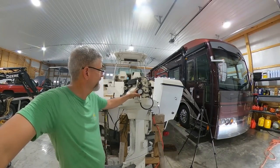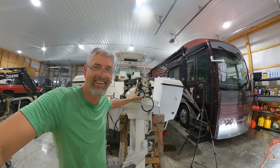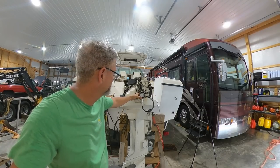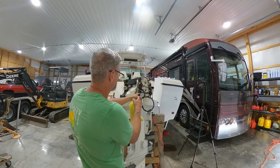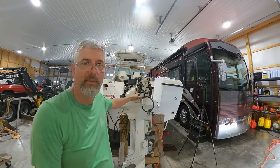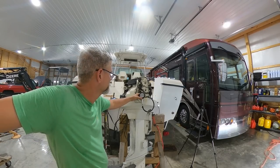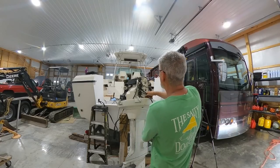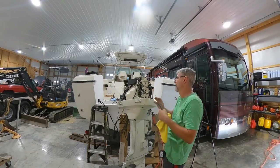All right, I waited and ran it again and we're back down to 60. So I got one cylinder at 60. Let me know where to go from here — I'll get out on the forums and read, but you guys can tell me too. It looks like about 62, but that's still low — not 70. It's hard to say really where it's at, but yeah, 60... let's see, it's probably at 64 honestly. So it's a little low still — we'll go with 64. One cylinder; all the rest of them are the same.